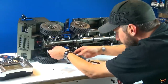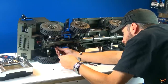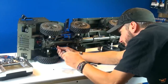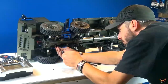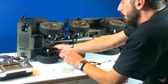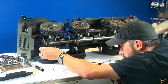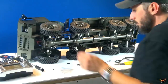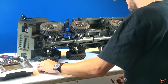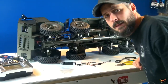Now if I can just properly get this steering horn - I'm not going to tighten it up yet. I need to position it to see if it's right; I can always adjust it with the trim and sub trim, but I want to be as close to center as possible. Two places to screw it in - onto the steering assembly and of course onto the servo horn itself. Just kind of cinch it up. Looking good, coming together.